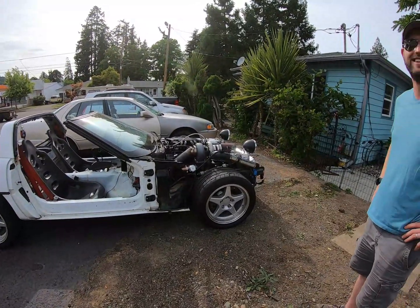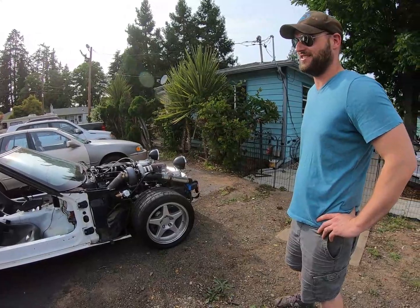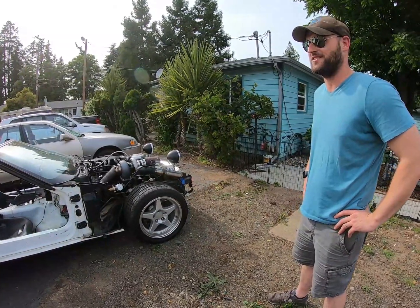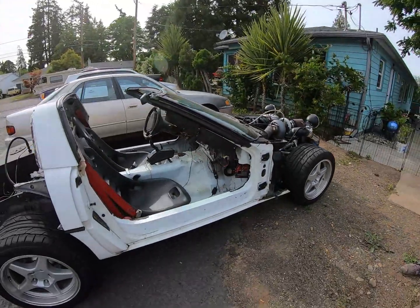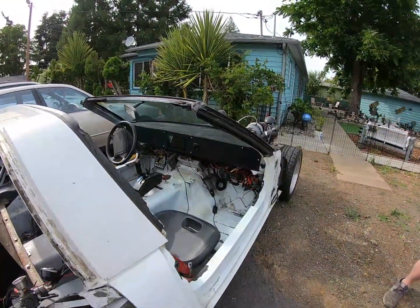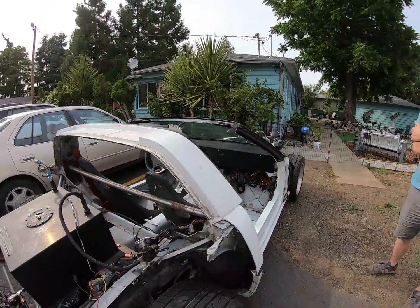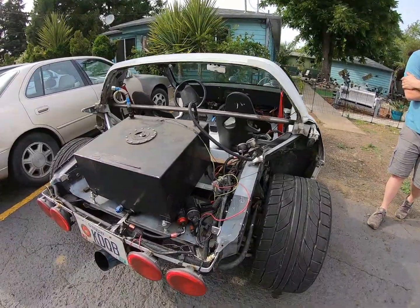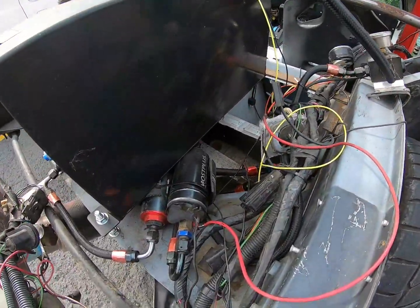Your car has an automatic diff still, right? Yeah, it's still 2.59 gears, so at the top of second you're doing like 80-90 miles an hour. I think mine has 3.40s because it's got a 440. What I was thinking about doing was getting the freeway-geared manual diffs - you can get them pretty cheap, like 400 bucks, and they're a 3.07 gear set and a little bit tougher.